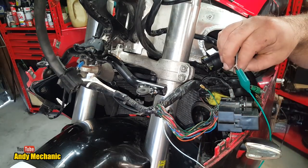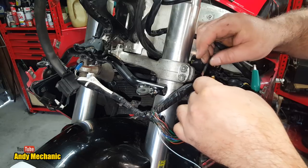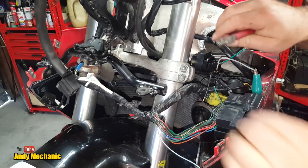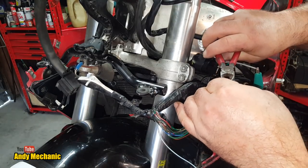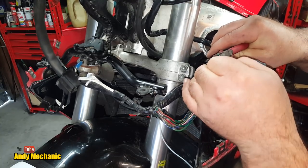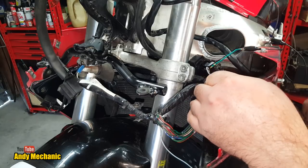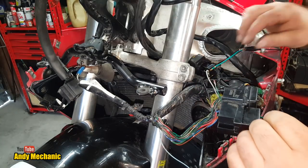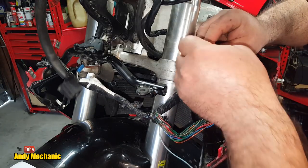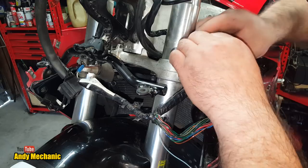So that's those two wires. Get rid of the jumper. So that's the black wire off that plug onto there. So we need to cut off that little connector. Don't need that anymore. Goodbye, connector. Just bear that back. Yeah. Cool. And is it gone? There we are. We need some heat shrink down there, don't we? So we'll put that on now before we forget, because I do forget. Must be getting old.